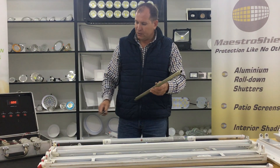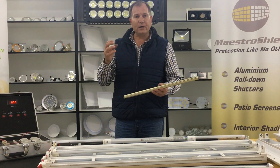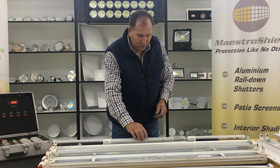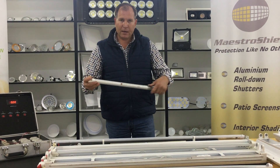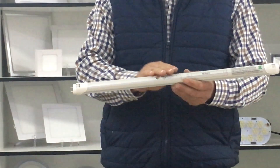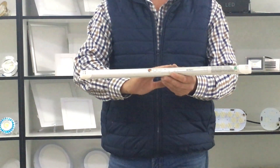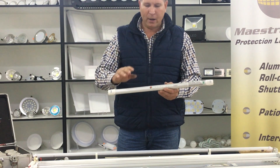It's quite a thick tube, so it does the job — it transfers all the heat from the diodes back to the tube. If you take a Jeric Holdings light that is completely built and tap on it, you will hear there is no vibration, because the heat paste and the strip are bonded to each other and can transfer heat from the diodes back to the tube quite well.